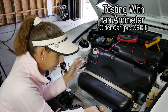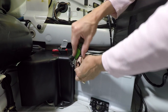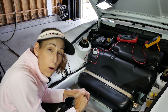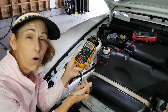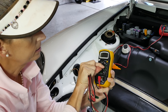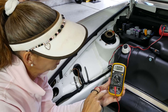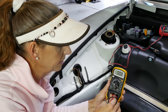Since this is an older car it's easy enough to disconnect the negative terminal on the battery - we always want to do this on the negative and not the positive terminal. Now we'll need a multimeter set to measure current or amperes. I'm using one of my smaller volt-ohm meters, set to DC amperes at 10 amps. These multimeters are designed for fairly low current, so you'll need to move your leads - there's an unswitched DC 10-amp receptacle, and then use the common in the center.